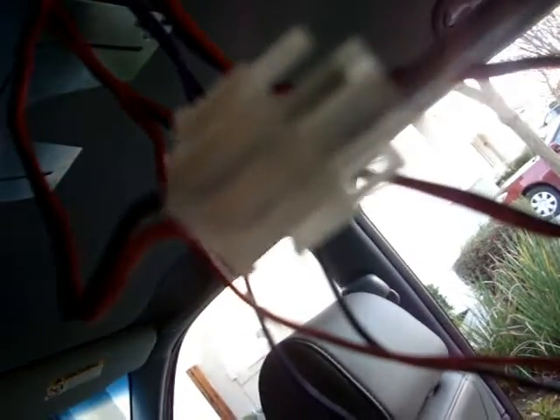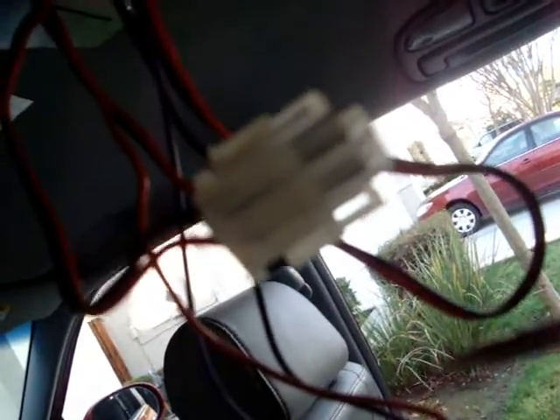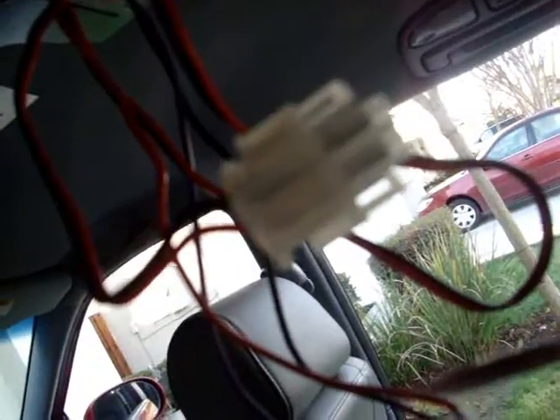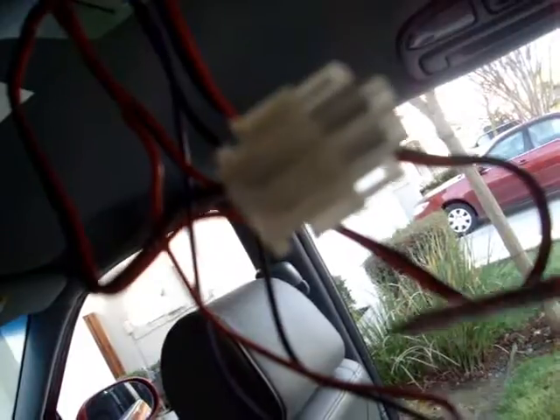You see the light is not turning on, but when you first turn on your ignition the light should come on. If it doesn't come on, then that wire is not good — you're gonna have to find another wire where, when you turn on your ignition to the first position, the light should go on. Okay, I turned on the ignition to the first position and poking again.